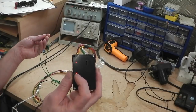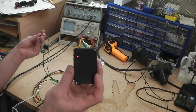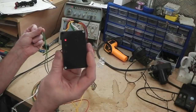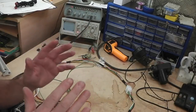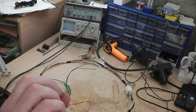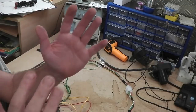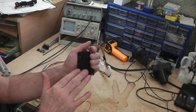So you still need it to have a delay for when I'm pressing off and on my brake pedal to stop that chatter, which I've just separated again, it'll come on in a sec. That's a second level of control, so you can't click, click, click, click, click on that brake pedal and cause what's called chatter in the relay, because I don't want to have the lockup plates going like that, it might damage them. I don't really know how it works, so we just want it gentle. So it's got a second level timer in it.